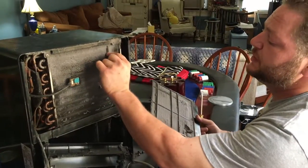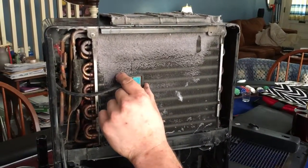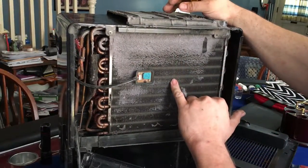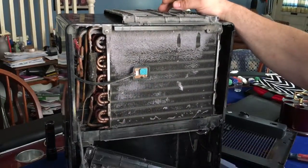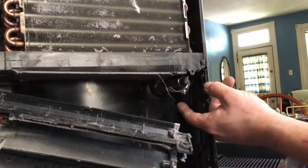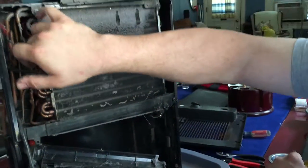This is all filthy, but this is what gave me the error code last time - all this buildup of dust on the actual evaporator coil. Here we get our first look at our evaporator coil, and just behind that there's another coil immediately back there which is the condensing coil. This here is the sensor for the little control module - it clips into the evaporator coil and snaps onto the tube inside. This is the coil that gets cold and where the water condenses onto. That's why the dust is kind of cruddy - it gets wet and then builds up in there. Down here is our catch tray where the water runs down, and that's where my condensate pump tube attaches.